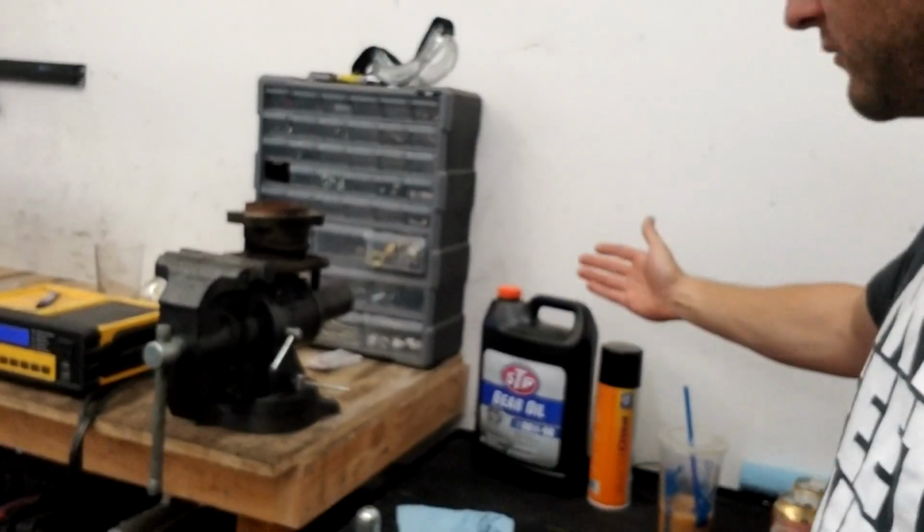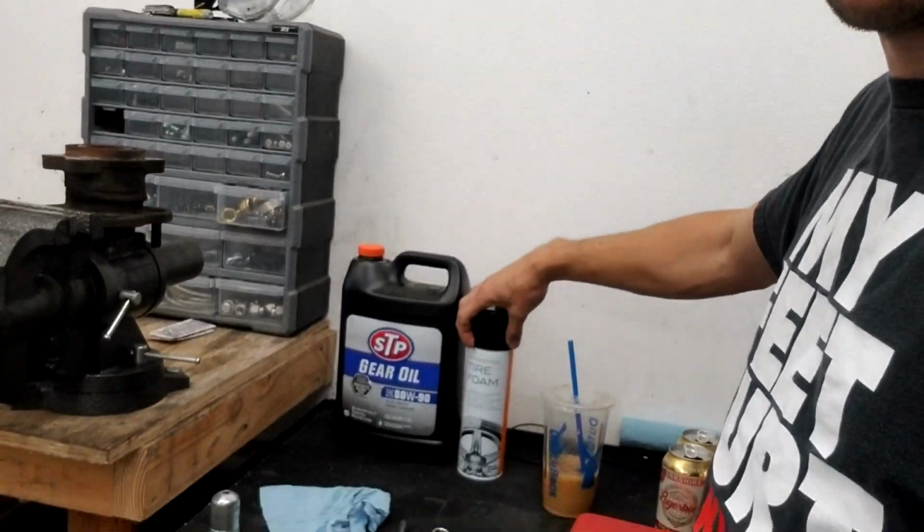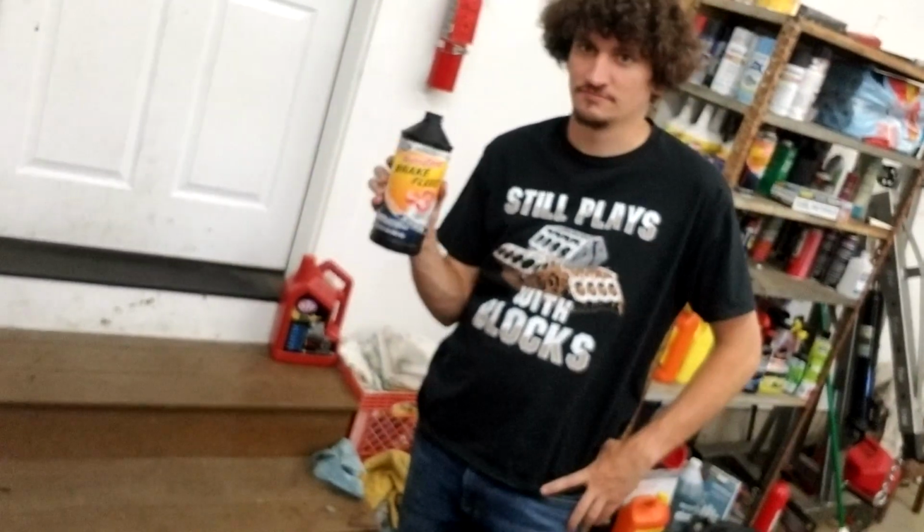It's a new day. We are no longer drunk. We are caffeinated and somewhat fed. And we've been to town. We got our gear oil for the transmission, tire shine for the detail job, and Department of Transportation number 3 fluid for the clutch bleed, which I believe is what we're doing next. Yes. Let's get straight into it.